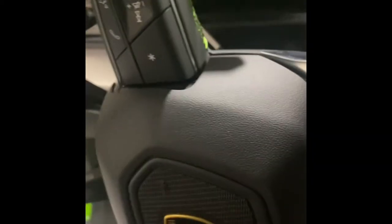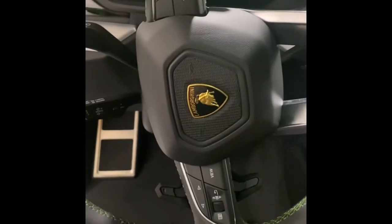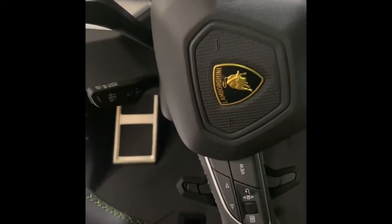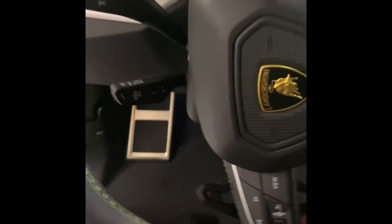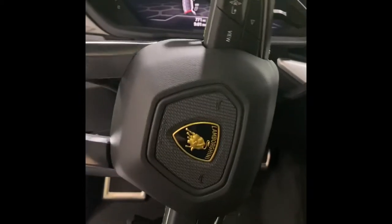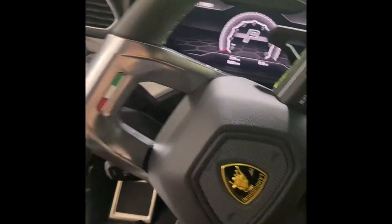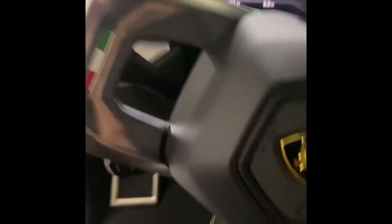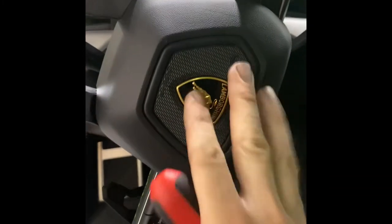One side is unclipped. When you release your screwdriver, it'll kind of pop right out. You have to go key-on to get your steering wheel unlocked. Because it's popped off at an angle, it's probably going to be hitting your airbag sensor — all it needs to do is press and make contact for that horn to go off.